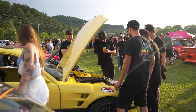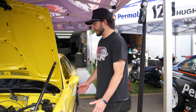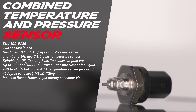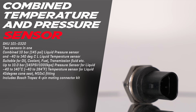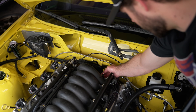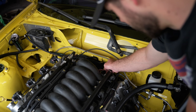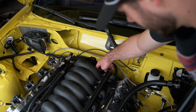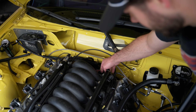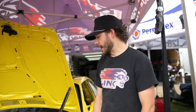I do love the simplicity aspect of these cars — I like making them very easy to use and simple. Link carries these combo sensors from Bosch; they're a temperature and pressure sensor combined. With this Link harness there was an extra temp output back here next to the oil temp sensor output, and I unpinned those and made a small jumper to combine them at the combined pressure-temp sensor in the valley. So I have oil pressure and oil temp up at the top of the motor on the back, and I don't have to run a sensor out on the oil cooler or in a line.